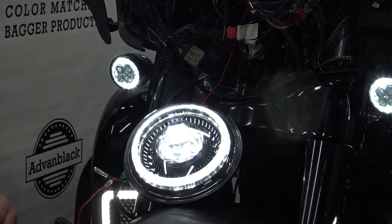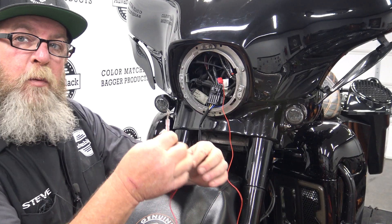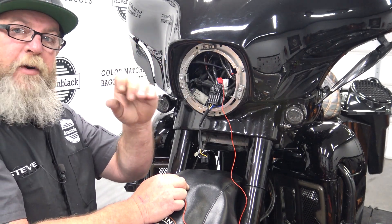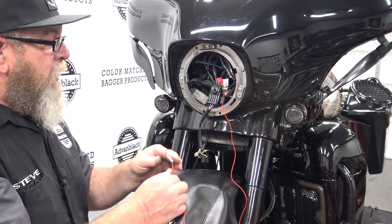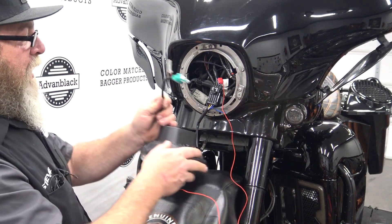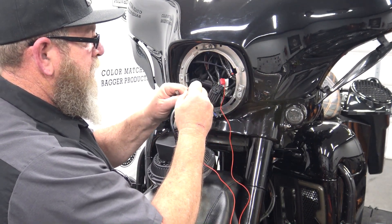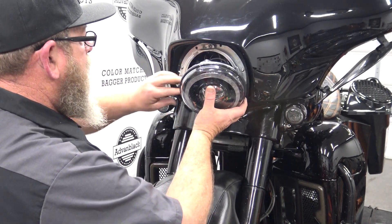Your halo light comes on, and as you can see with the high and low beam that does not change. With this red wire you absolutely can connect it to any accessory-on wire that's underneath your fairing. On the inner fairing you have that little auxiliary cigarette lighter port — that's going to be a key-on accessory wire as well. It does not take a lot of power to run the LED halo. Once you have that clamshelled on and connected, take the red wire and plug it into the red on the back of the headlight, then tuck your wires back in.